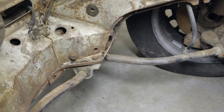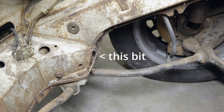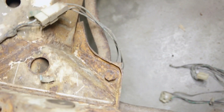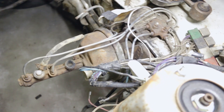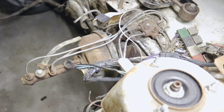I need to do a little bit of work here on the sway bar mounting because you can see how the plate is pulled away from the body of the car. I'll have to deal with that, but I'm surprised it's not worse — famous last words. This side is a little rusty also, being underneath the battery area, but it looks to be mostly just surface rust. There's plenty of room — we'll see how the brake booster and brake master cylinder integrate with the Fiat engine and transmission together. That's work for another day.